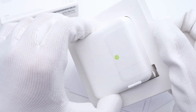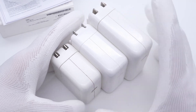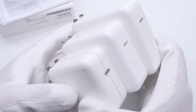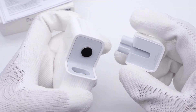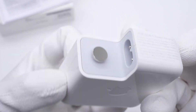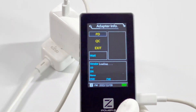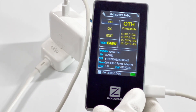This is not the default charger for the 15-inch MacBook Air — you have to buy it separately. The brand new 70W is slightly smaller than the previous 67W and slightly larger than the Apple 30W. The round metal block can fix the AC block, and it can also be used as a ground wire when you use a 3-prong plug. The serial number inside the input socket can be matched with the adapter info of the Charger Lab PowerZ MF001.